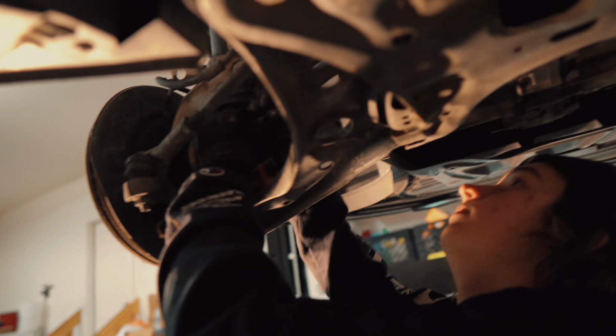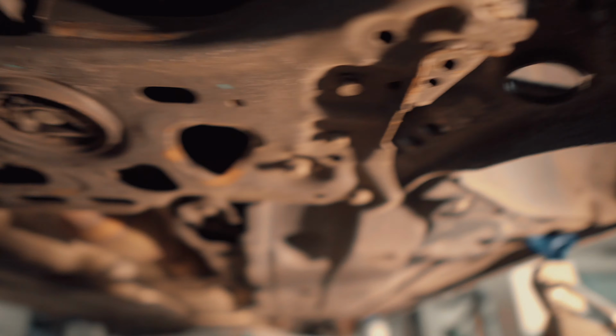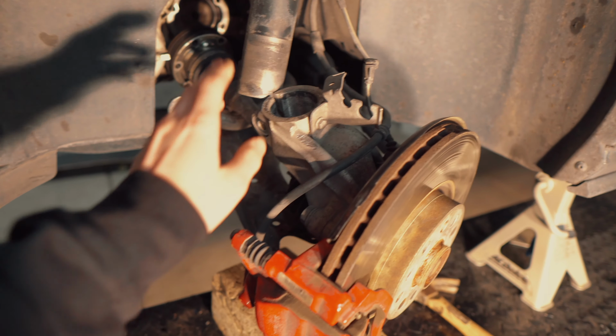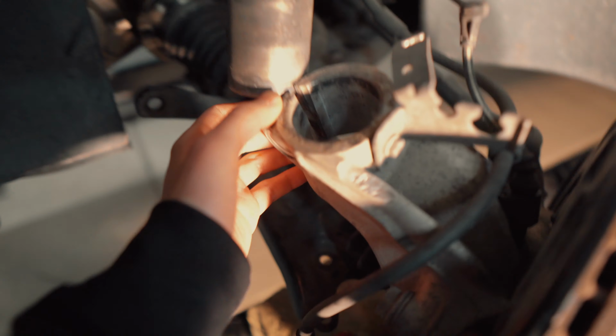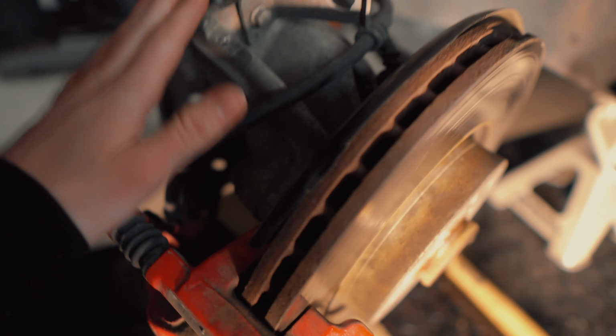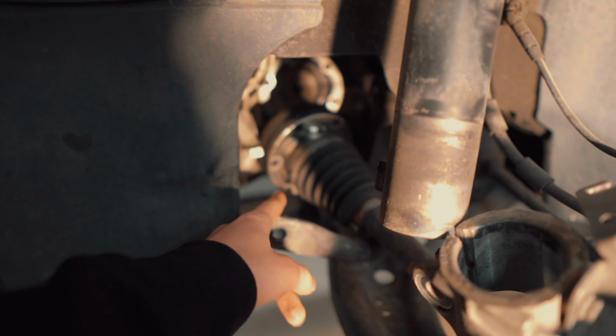Jordan's gonna pull out the axles to get the struts out in here. You see the axles connect there and there, and that'll just make pulling the struts out a lot easier. In progress on the front struts here. We got this disconnected. You just need to spread this clamping piece down here on the bottom and force this off. We use a hammer and we put pressure on it and it'll pull this off, and it makes it a lot easier to disconnect the axle back here.